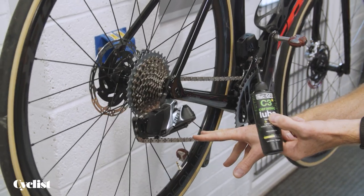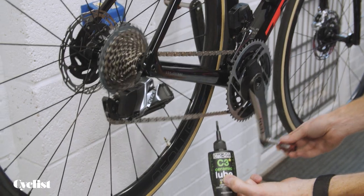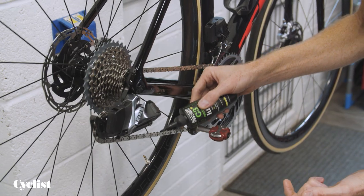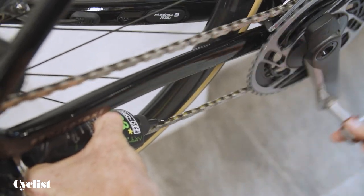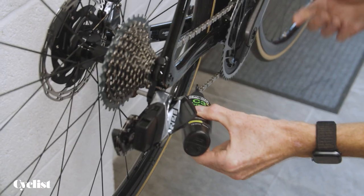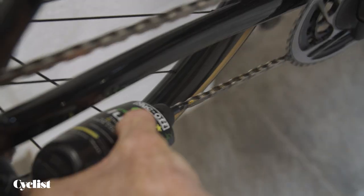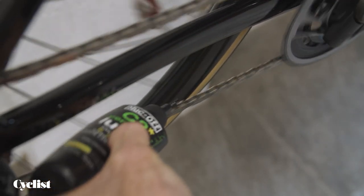I would use this area here as I said before, and a good little tip is to find your joining link and use that as a marker so you know how many revolutions you're applying your oil in. Some people like to drip on one link at a time, systematically moving along, but I'm not a massive fan of that — I don't think it's necessary and it's quite time consuming. I think you can just drizzle the lube on in a controlled fashion and keep that chain moving. Start by aiming for the middle of the chain for the first revolution, then move the nozzle to the left-hand edge of the chain, dripping lube into the outer plates. Then move to the right-hand edge and do another revolution — just drizzling lube on in a controlled fashion.